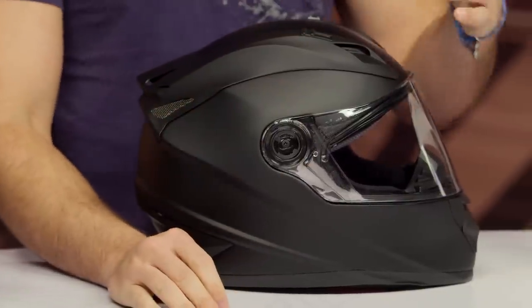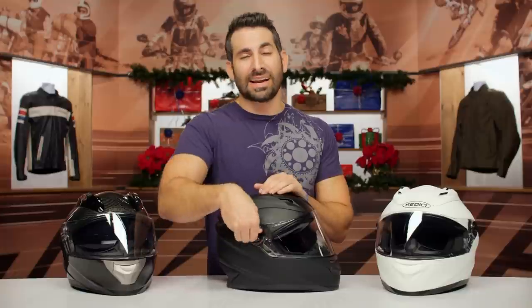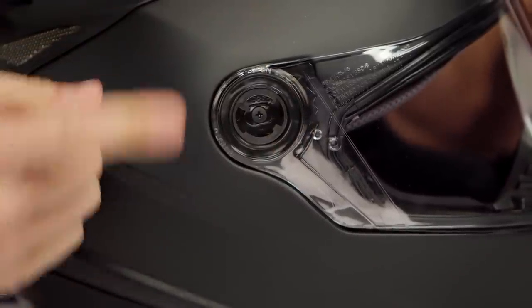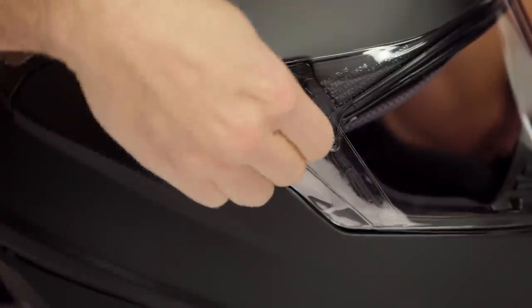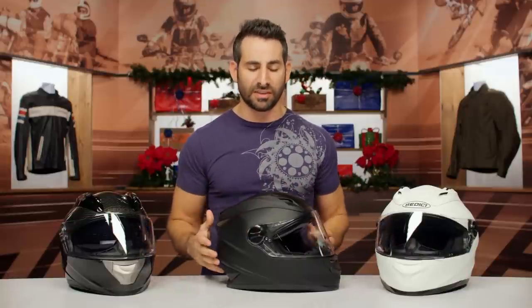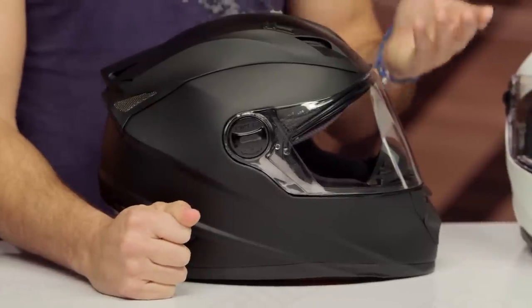My biggest gripe with this helmet — objectively, the biggest issue I have with all three of these lids — is the actuator that holds your shield on. We've seen locking mechanisms on thousands of helmets, and these locking mechanisms need to be improved, flat out. If you don't make sure you hear that click, they don't lock into place. You're using this and not checking it pre-ride, and what's going to happen is it's going to get loose and you're going to lose it. That just fell off — that's done that twice. They're heavy enough that with vibration on a bike they're going to fall off. This is something that can be replaced, but just keep it in mind — it's the only major flaw I see on these helmets. Part of your T-CLOCS pre-ride checklist should be making sure your side shield locks are clicked into place.